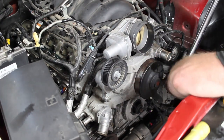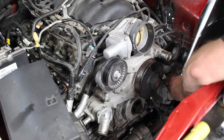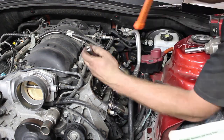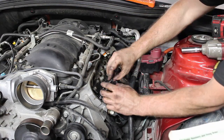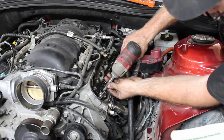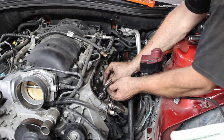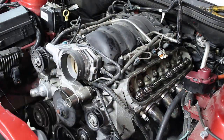Well, it's 1 o'clock in the morning, and I'm working on this thing. I was making good progress, and I was getting ready to start doing the rocker arms and all that. And I realized that his push rods were 7.45, which seemed odd, because normally we run 7.4 unless there's something different about them. I checked, and sure enough, the stock ones were 7.4, but the ones that came with this kit were 7.45.